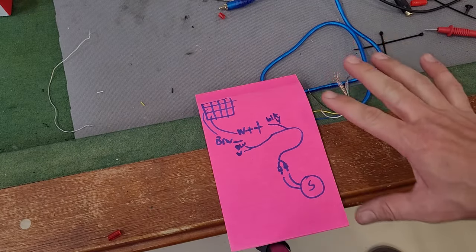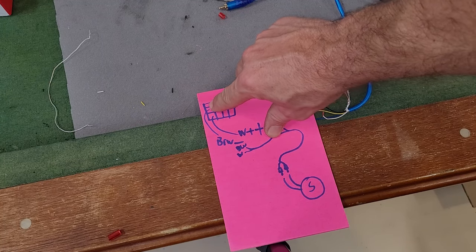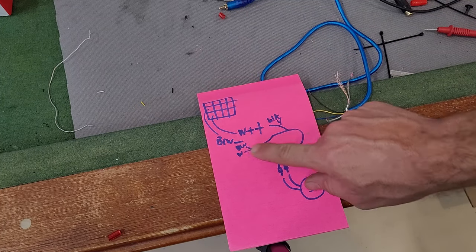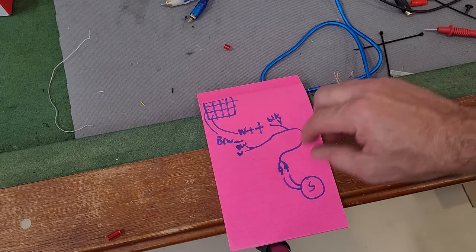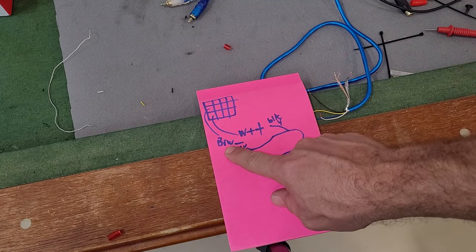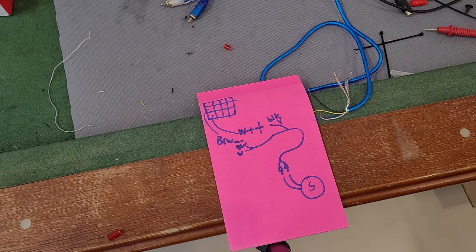I'll put this all in the description. On your amp there's a connector with 12 pins — pin two and three are brown and white. The white is your positive RCA signal and the brown is your negative RCA signal. Since there's only two signals, we need to combine to make four inputs: white positive goes to black and yellow; brown negative goes to white and blue. That'll connect our cables.